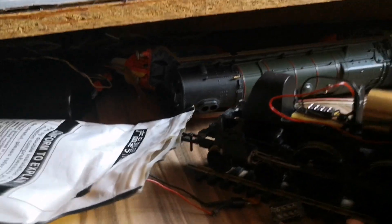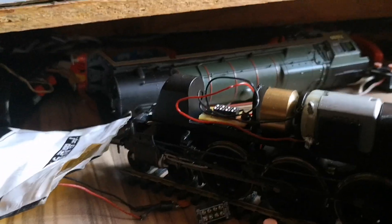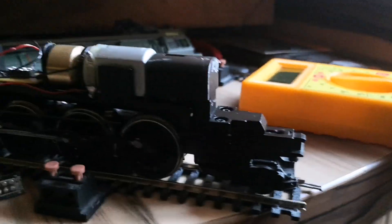So I'll now put this onto ohms and I'll test the motor. But first of all, what I will do is disconnect the voltage and test that there's no short in the chassis. I happen to know that there is, because I tested this earlier and it does test as though there is a short.